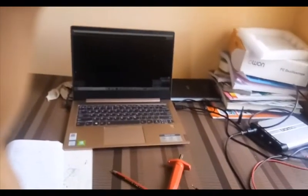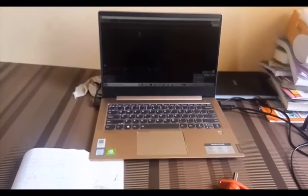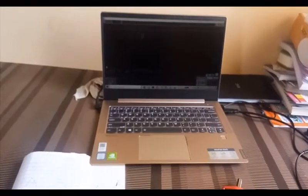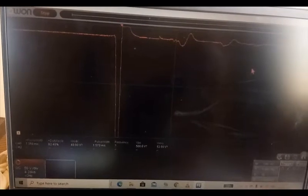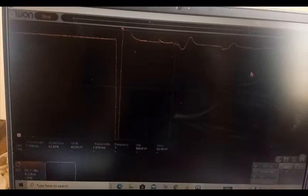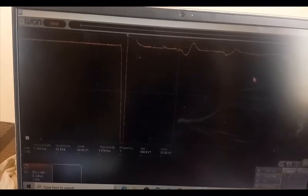Now I am putting it in single sequence mode again and going to hit it with a hammer. You can see the voltage generated. This time only one side peak is showing — approximately 450 volt. Because of scope limitations, the full waveform is not captured properly. If you see the total peak-to-peak, it may go up to 1000 volt peak to peak.